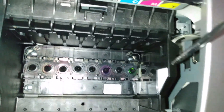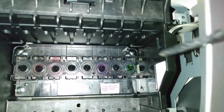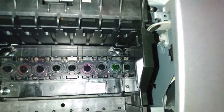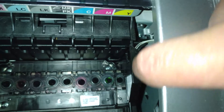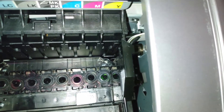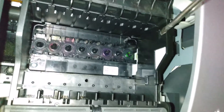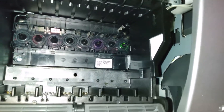Before you take the screws out, you want to remove this plastic cover, which covers the ribbons. The easiest way to do that is to put a flathead screwdriver in there and tease it up — there are sort of two clips behind it as well, so be really careful because you could crack it off. I'm just going to go in and try to tease this up.